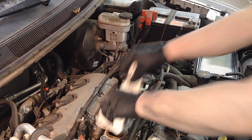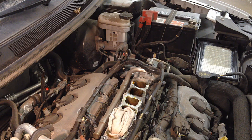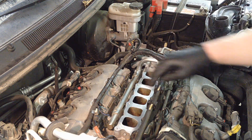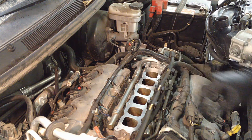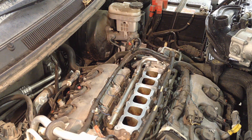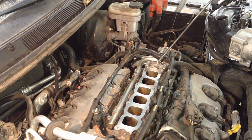First thing after all that is to pack these holes. Make sure your sealing surface on the lower intake is nice and clean — scrub it up, then wipe it down with some brake clean on a rag. Then do a final cleaning of these ports with compressed air if you've got it.